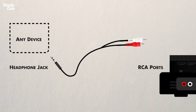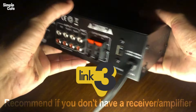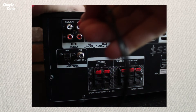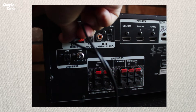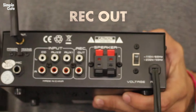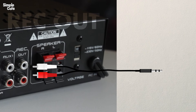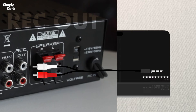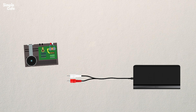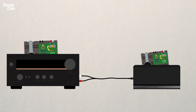What's more common is connecting your device to an amplifier or receiver, and your receiver may have multiple pairs of RCA ports. If there are so many, which one are you supposed to plug into? Don't take the names literally — those are just suggestions. You can plug into any of them as long as it's not marked REC out. That REC out set will instead be used to send audio out to your powered speaker, like one with an RCA or aux port. But connecting an active speaker to an amplifier is rather redundant because an active speaker already comes with its own internal amplifier.